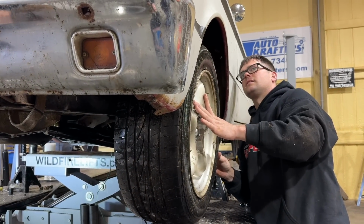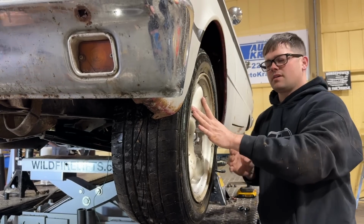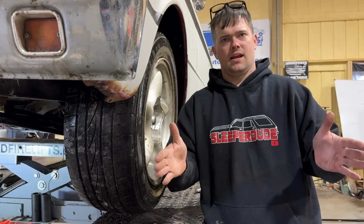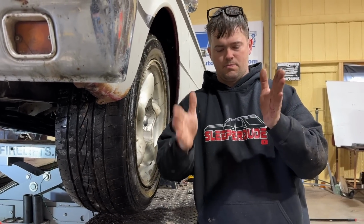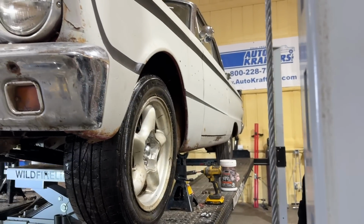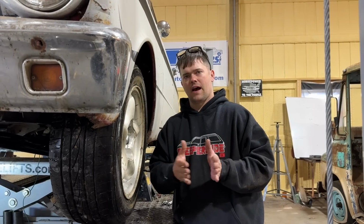On the outside? Yeah. If you flared this a little bit, you know what I'm saying? If you don't know, a 7-inch rim is actually 8 inches wide. So it's 7 inches bead to bead, not outside to outside. That looks so good on there. So it'd probably have to be a 7. Yeah, it does look aggressive, doesn't it? It's probably gonna have to be a 7-inch rim with 3 in the front and like 5 in the back.